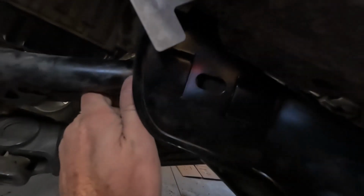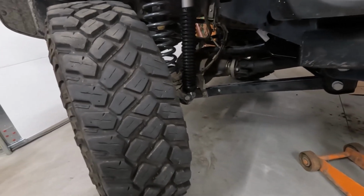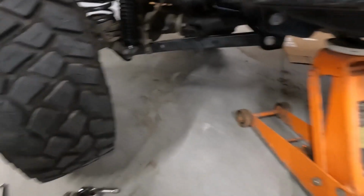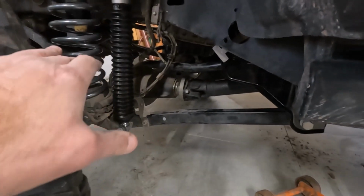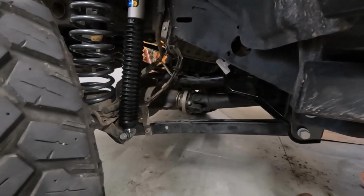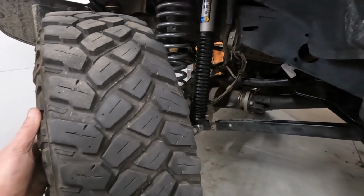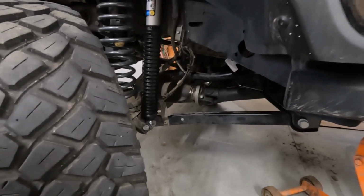Again, we are not even close with the upper control arm, so hopefully my little jack trick will work on this one too, but I'm concerned because that's way off, so we'll see. Okay, I think even though the instructions say to put the wheels back on, I'm going to take them off because my jack isn't high enough. This is still hitting the ground, and I need the axle to be free so that I can twist it forward a little bit, which the instructions for the geometry brackets do mention doing, but not at this step. They don't mention taking the wheels off. They just mention making sure the axle is off the ground and free. So with the equipment I have, I'm taking the wheels back off and hoping I can figure it out from there. Maybe some ratchet strap action. We'll see. We'll get it fixed.